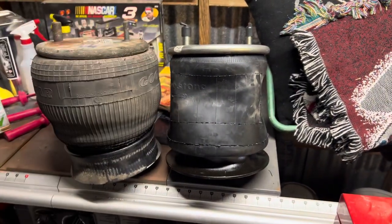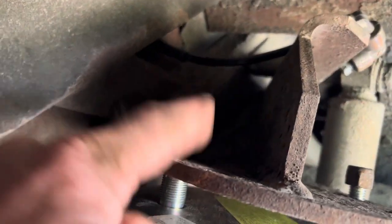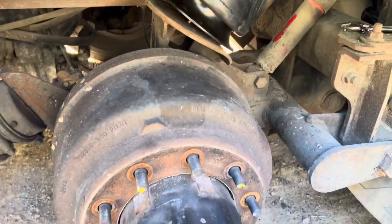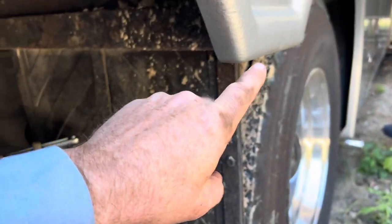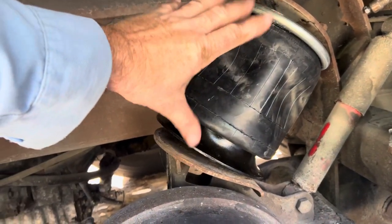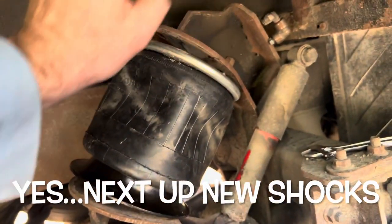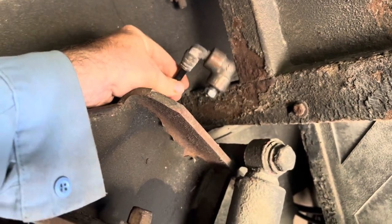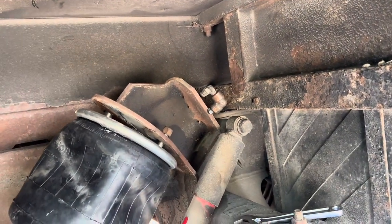We're going to get it out there on the motorhome. The holes match up exactly perfectly. We've got our nut started back up here — this is where the airline fitting is going to go back on — and we've got our bottom stud nut started. I've got the tag axle lowered all the way down just sitting on a jack, and then I raised the coach manually on the front bag here to get this opening back apart. The bag slid right in there. We'll get it all tightened down, then work on getting the airline back in. We need to dump all the air out of the system completely, then separate the airline off the fitting so we can hook it all back up.